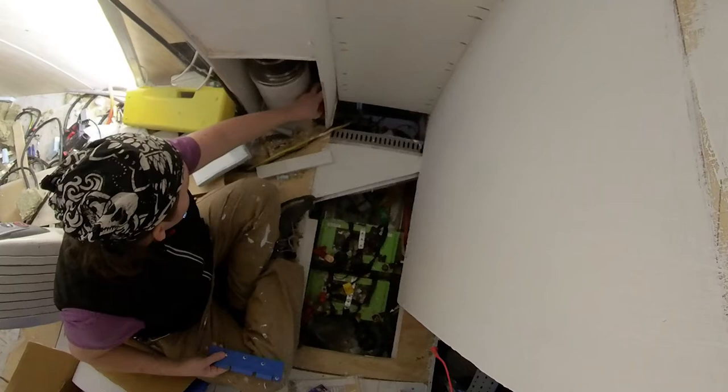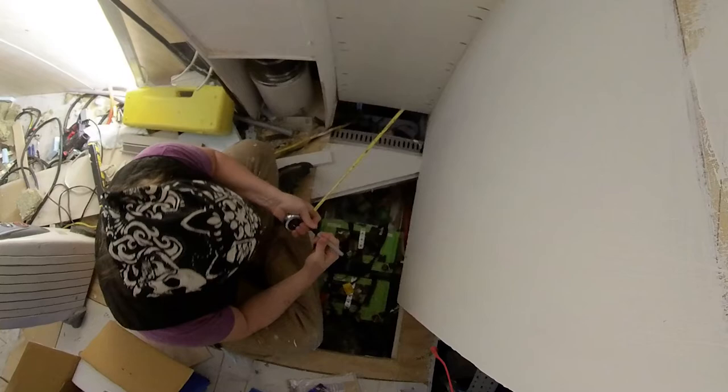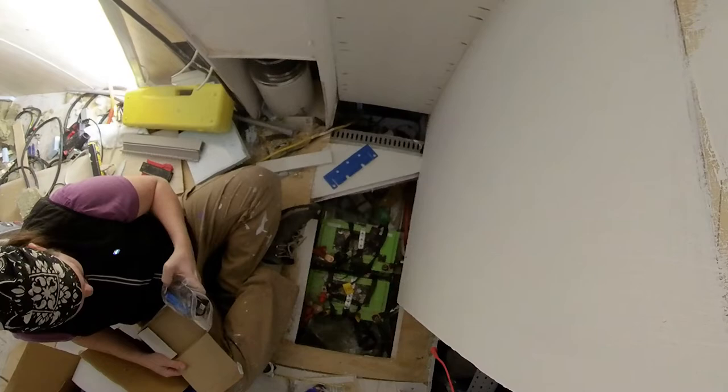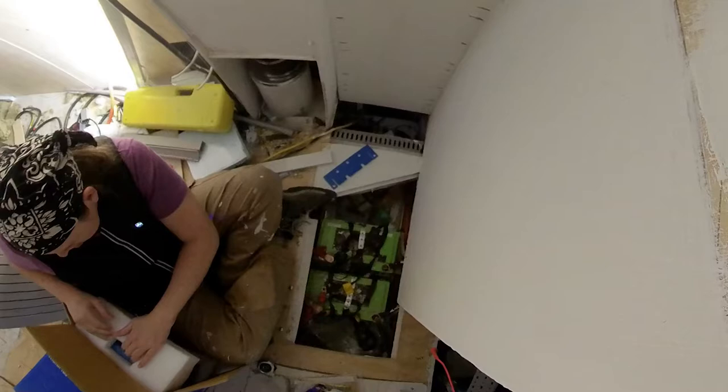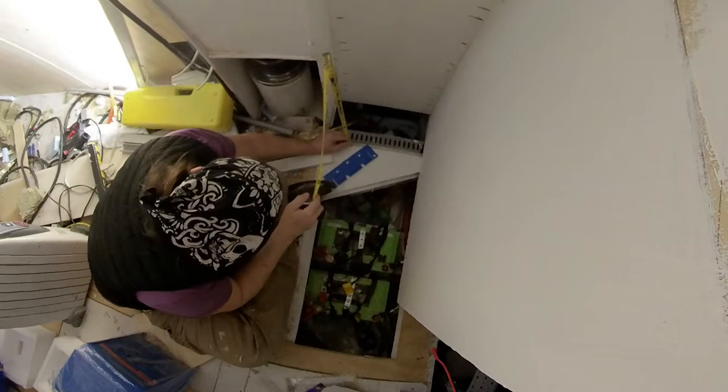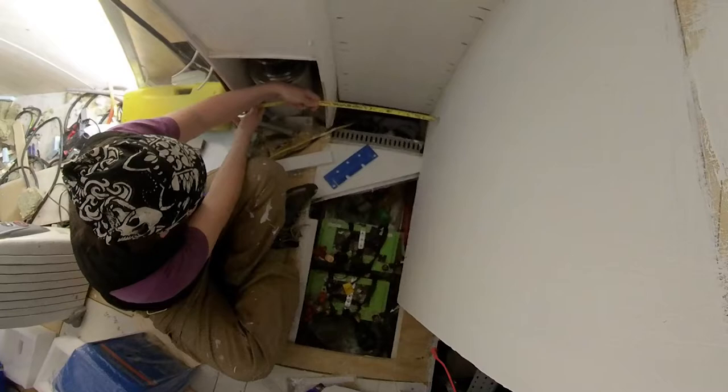Actually, my conversion from centimeters over to inches was quite a bit off. Initially, I thought it was 4 inches on either side, but I remember pre-measuring it and knowing that I had the room to do it in the pocket. So I ended up cutting this section out for no apparent reason other than bad math. That being said, it needs 2 inches on either side of the inverter to keep it safe. Not 4 inches on either side, but 4 inches altogether. So I'm going to do some cutting. Unfortunately, hindsight is 2020 and foresight is not.